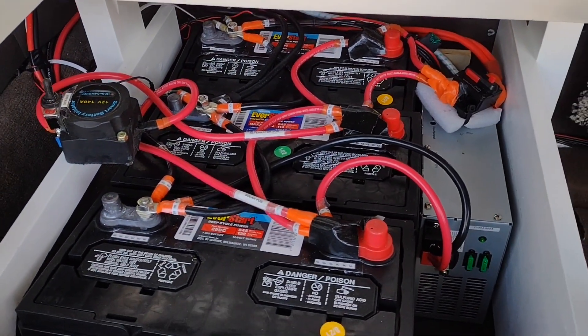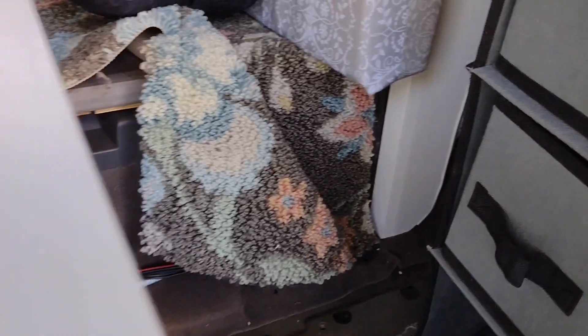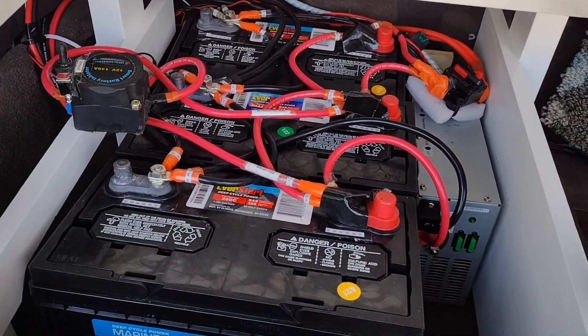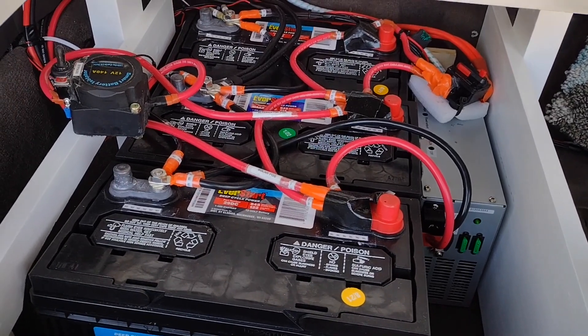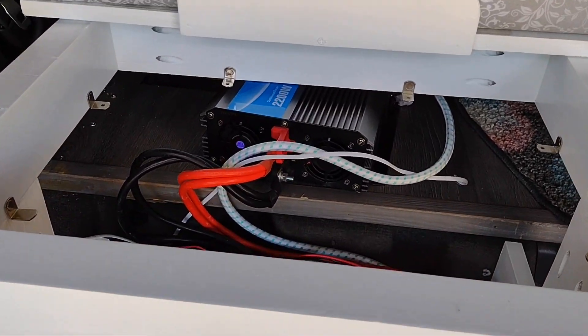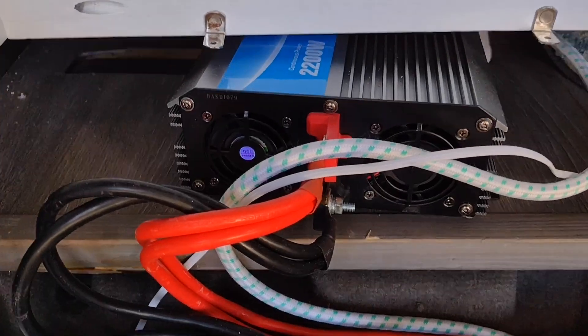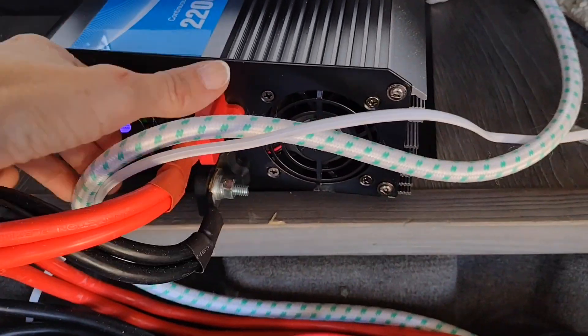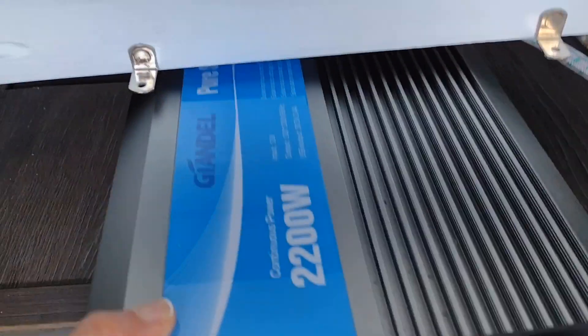This will stop the flow if I get too low on those. The three batteries are wired together this way. There is hard wiring for the refrigerator going straight from the batteries, running behind the cabinetry so the refrigerator stays plugged in all the time. The power plugs for things like lighting and charging stations are also directly powered into the batteries. The inverter is a 2200 watt pure sine wave inverter, which is currently sitting on the floorboard because I've taken out the cover that normally goes over these batteries.